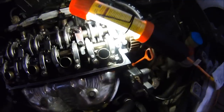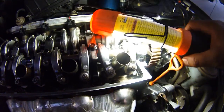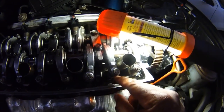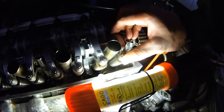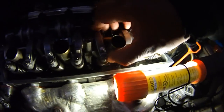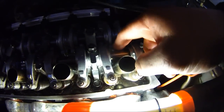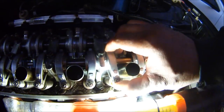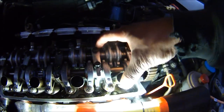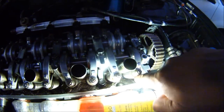And that's how you adjust your valve lash. Now something important: in order to do that, the rocker arms have to be off of these valves. You want these valves to be movable — you want to be able to move them like that. See on these ones that are tight, you can't move them at all. But on these you can move them because the lobe of the camshaft isn't pushing this rocker arm down, forcing the valve down. It's actually off, and that's where you're getting the valve lash — the gap in between there. So make sure when you do each cylinder, the rocker arms aren't putting pressure on the tip of the valve.